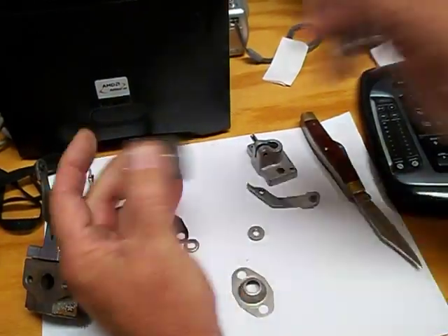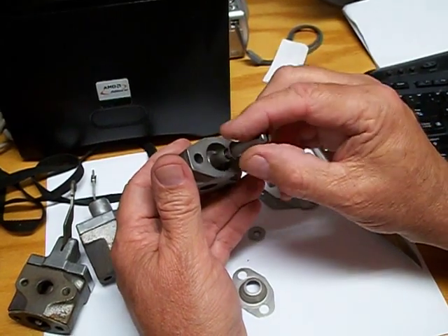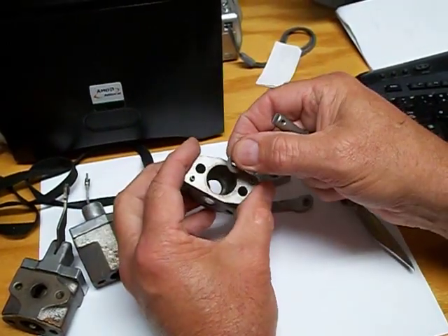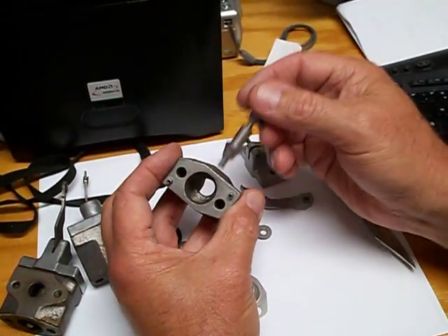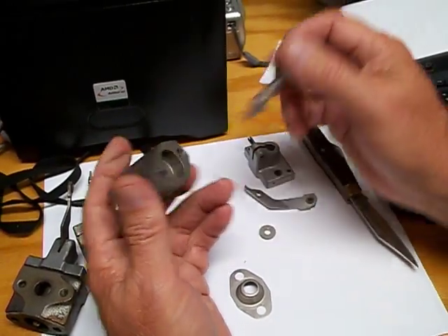What has to happen on these old ones is that the seats have to be milled somehow with maybe valve lapping compound, so they seal up real tight at idle and wide open throttle. Otherwise exhaust gases will upset the idle mixture, but Phil is making new bodies.